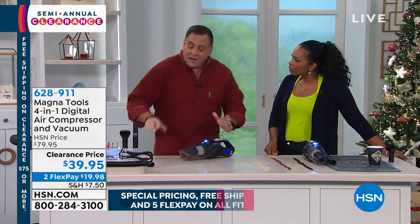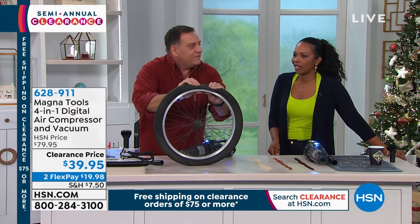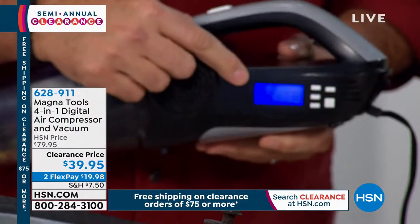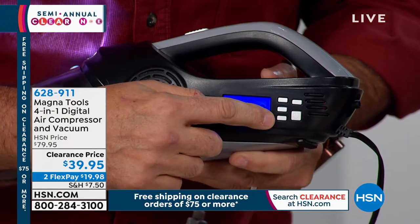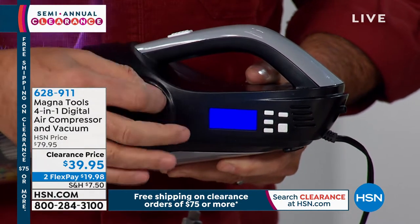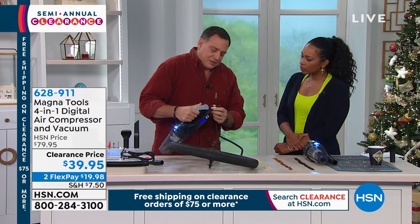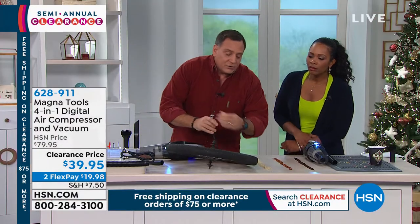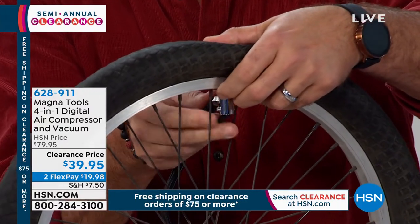Now, what if you wanted to fill a tire? I'm going to bring this tire over here. This one is flat — you can see a very, very flat tire right there. It's anywhere around one on the pressure gauge. This is a digital pressure gauge with a very nice big readout. You can actually set the pressure you want by using the plus and minus buttons. When it reaches the pressure you set, it will turn itself off, so you don't have to sit there and babysit it. The hose fits on the back — you just stick it on this nipple here and push down. Then you hook the other side up to a tire. If you don't know this, tires will almost always have the desired pressure written on them.